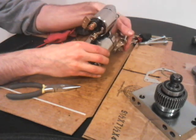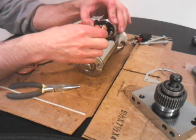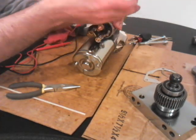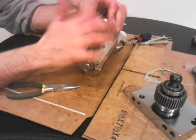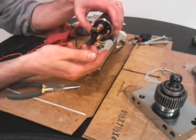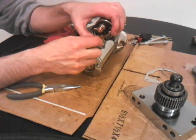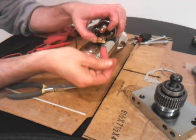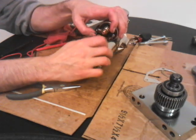Next, make sure you connect the solenoid — it goes over here like so. Now, be careful here. It doesn't matter which terminal you put this on in terms of polarity, but certain cars have certain spots where you want power all the time. You would want to put this one on the side where it's empty — nothing connected to it; most cases it's empty. And the other side — the two thick terminals — that's where you put everything else: the battery cable goes directly there, along with any other wires, fusible links, and stuff like that.